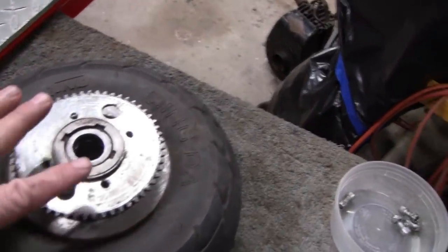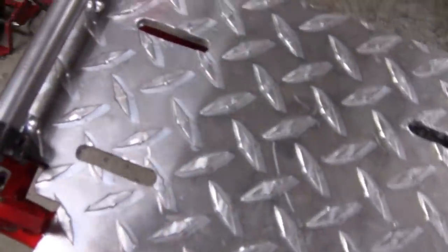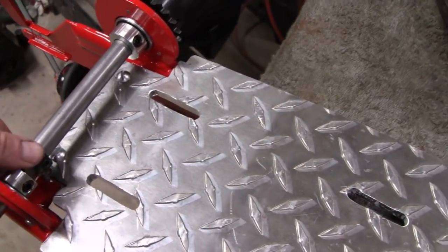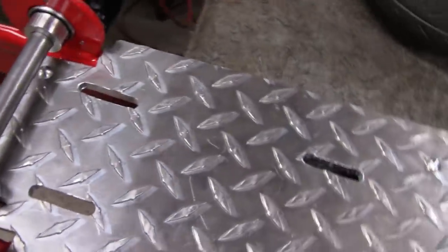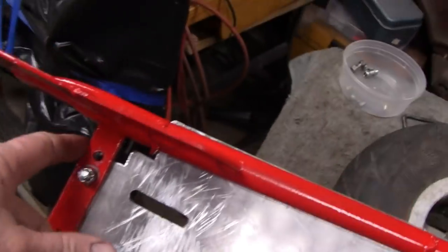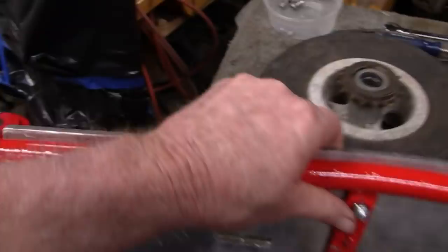So for the time being, I ordered a 41 chain sprocket to go on here — I think it was a nine tooth. But as small as a nine tooth is, it's still gonna be bigger than this, and that's gonna take some modifications. Probably have to cut this out and possibly move the bracket. That would probably mean notching this bracket out or actually moving it and bringing it up here. So you're talking a major modification there.